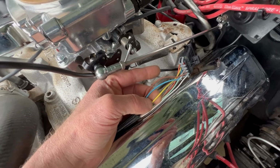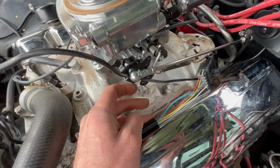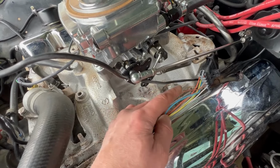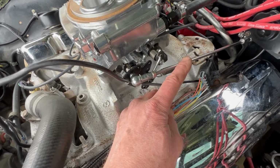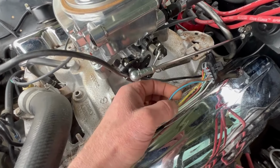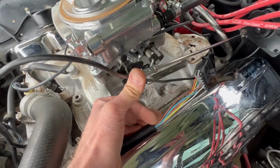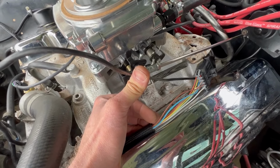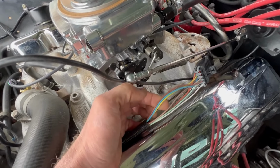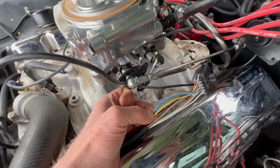So I'm going to have a relay because it's a TH400 automatic gearbox. There's a kickdown solenoid, which originally was mechanical off the old carb. When you put your foot on the accelerator, at some point it would activate a mechanical valve in the gearbox, which would then increase the pressure, so when you put your foot down, there's a kickdown. But now there's a solenoid on there, so one of those is going to be a ground earth again for a relay. You can set that for 96% throttle. So when the throttle's at 96% or 90%, it will actuate the relay, which will actuate the solenoid in the gearbox, and that will increase the pressure in the gearbox. So the three wires I'm going to route elsewhere. Again, that's something I have to do later. It's not essential to the startup of it, but I will go down that route later.